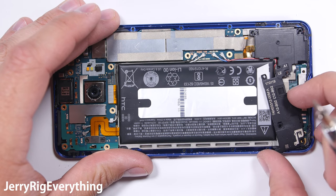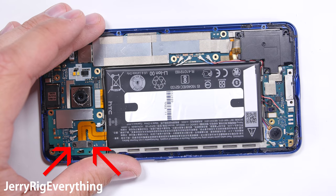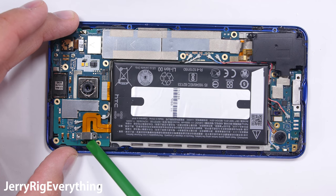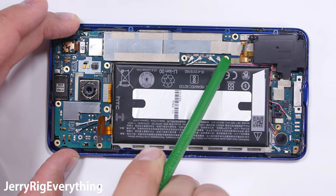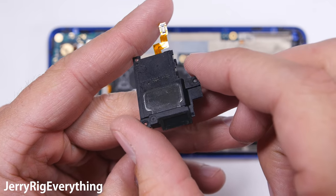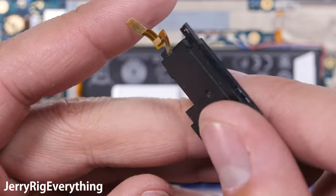The bottom plastic shield also lifts off. Before I unplug anything electrical on this phone, I'm going to disconnect the battery. This has two screw holes directly in the plug, which is interesting — normally there is a thicker metal bracket over the top to keep it attached so if you accidentally drop your phone it won't unplug by itself. The loudspeaker at the bottom of the phone has its own ribbon connector. I call these Lego connectors because they literally snap on and off like little Legos — you'll feel them click into place.